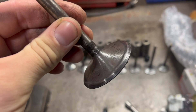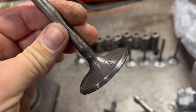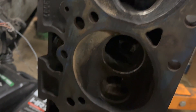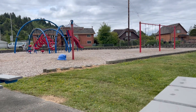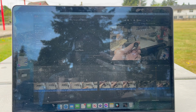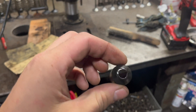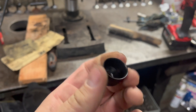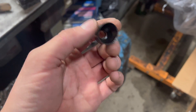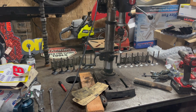What you'll be looking for is a nice line, kind of like you can see on this valve now. They'll be in varying thicknesses, but it should be consistent all the way around — no dark spots through your line. Should look nice, and you should have the same on your valve seat. If you can't get a nice consistent line on your valve and valve seat, it's time for a trip to the machine shop. Ditto if your guides are worn out. Then it's time to assemble your heads with new valve seals. These were actually rebuilt not too many hours ago and have nifty positive seals on the intake side, which I'm probably just going to leave alone. But I think I'll replace these exhaust valve seals. That's pretty much it — a lot of elbow grease, attention to a couple choice things, and time. Also a horrible mess, as with every other process.